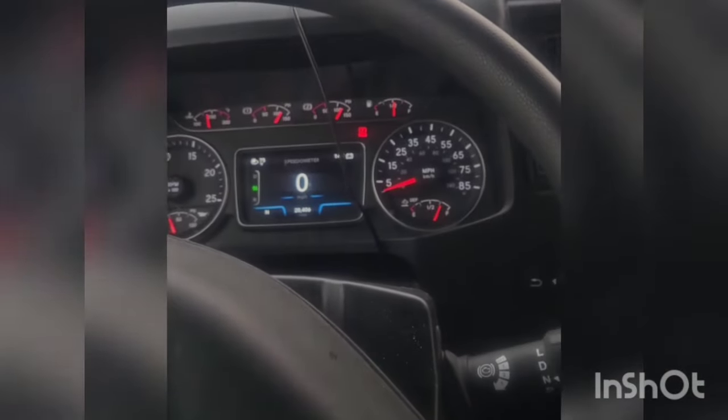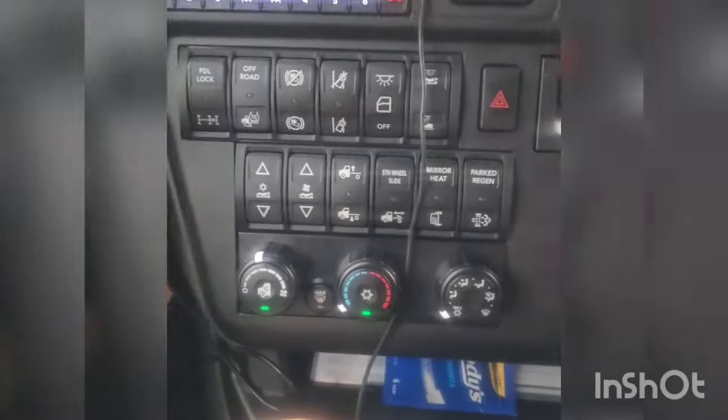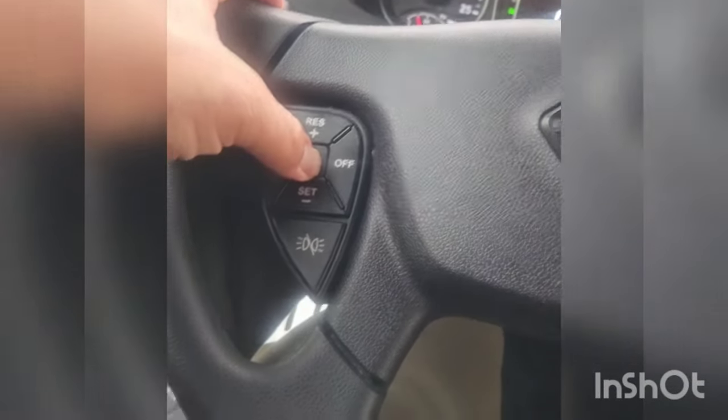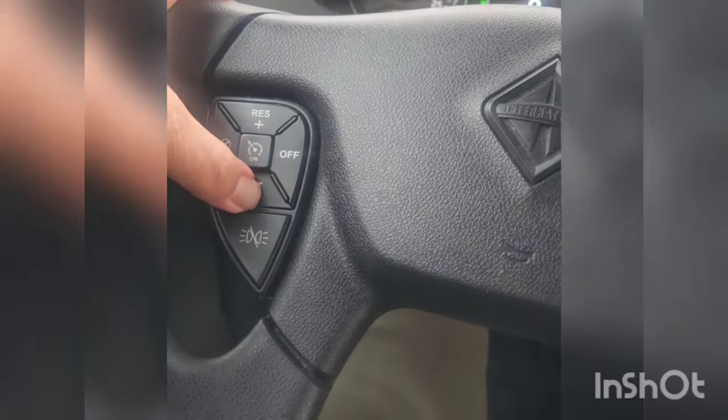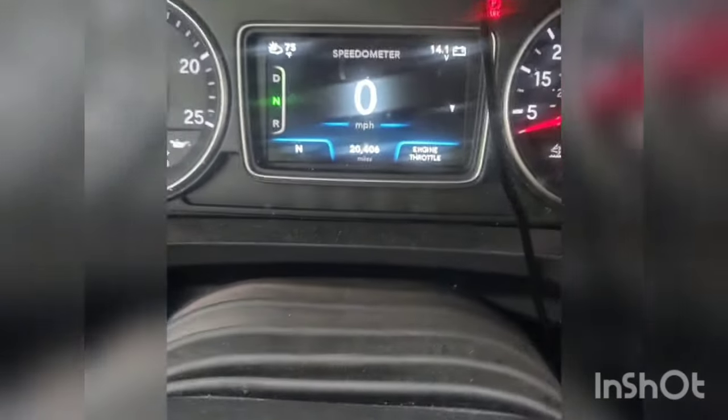A few things you can do. If you just want the truck to run without using your bunk heater or bunk AC, here's what you do. Press in the yellow right here — you're trying to brake, press that in. Keep your foot on the brake pedal and press the ON button. Then hold the SET button down, and while holding SET, reach over and pull the yellow. You should then see 'engine throttle.' If it says engine throttle, you're good all night. See where it says engine throttle right there? That'll keep it rolling all night.